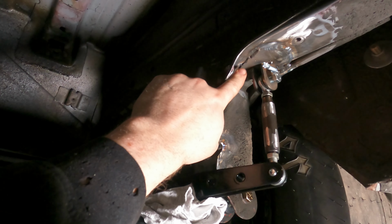And what we're gonna do up there is I think we're gonna bend a couple pieces of tube, hopefully that inch and a quarter for sure, and get that mounted. Like I said, that's gonna be like a main hoop back here. The intercooler sits in front, rad behind. And hopefully with that in place, we will be able to get some of this stuff in the front wrapped up, and then I'll go back to do the motor mounts. I'm not feeling the motor mounts tonight, kinda wanna bend some tube. So let's get to it.